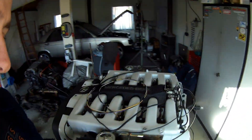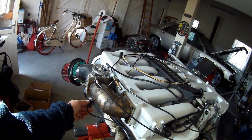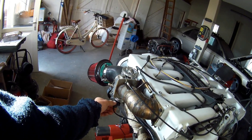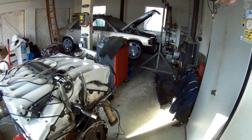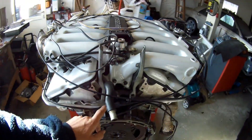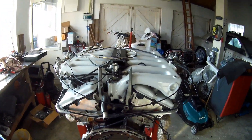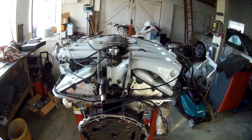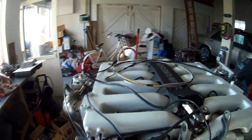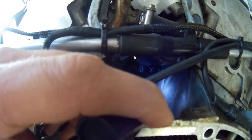What I did already — because I've got some wiring in the back of the engine that I cannot reach when the engine is installed — I started here with the throttle position sensor and rewired it, because everything has to go to the passenger side where the ECU will be. I also rewired the two knock sensors, the only two sensors I really cannot reach when the engine is in the car, so if something is wrong with those I'm in pretty big trouble. You can see those two sensors are wired up — one over there, one over there.